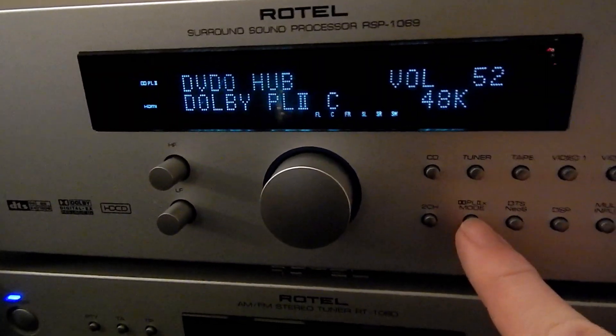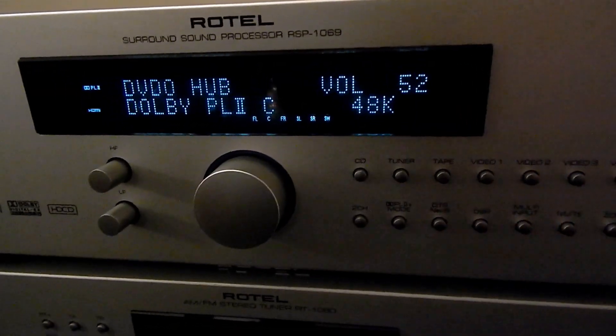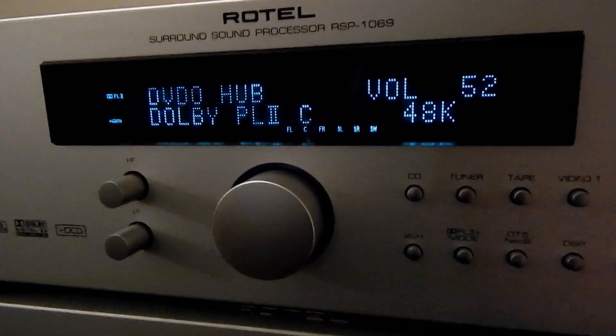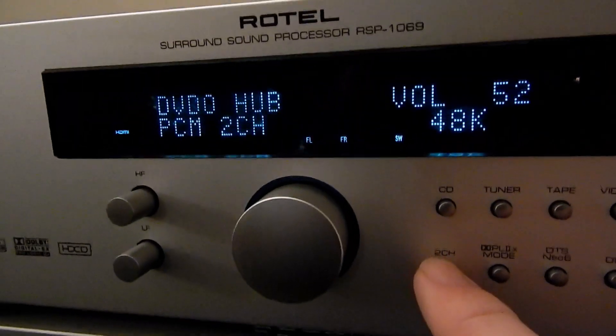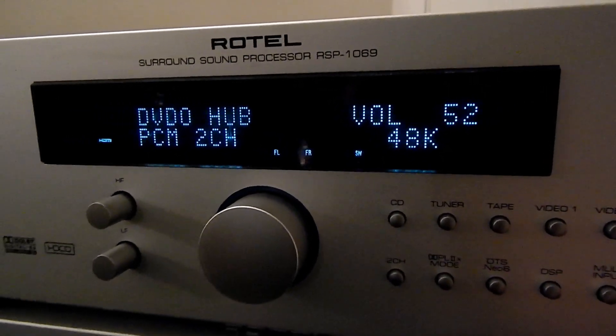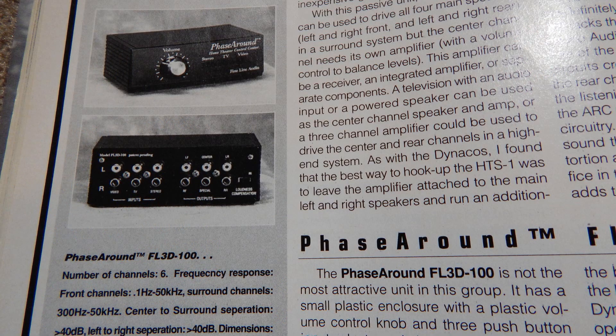The cool thing about ProLogic was that once you set it up it was a set-and-forget situation. If you put ProLogic on Video 1, every time you fire that up it already has ProLogic enabled. On my Rotel receivers I just set it for each input — if I want to override it to two-channel for a music video I can, otherwise it always defaults to ProLogic. If you have an older receiver without all that, you might need an outboard decoder or separate processor, but all you need is that ProLogic logo to get going.